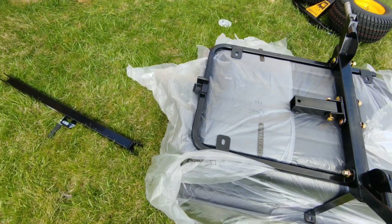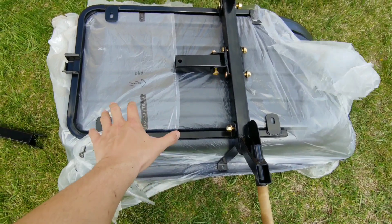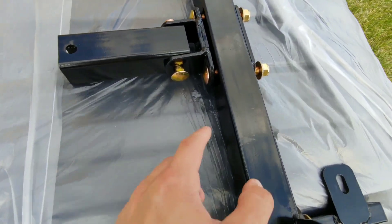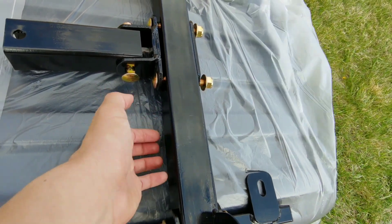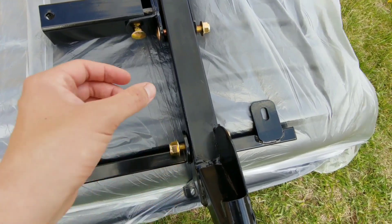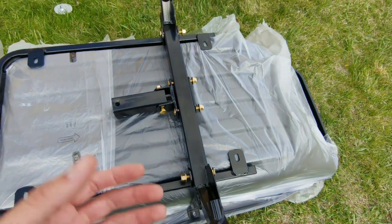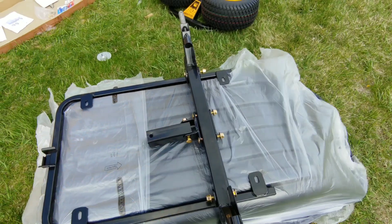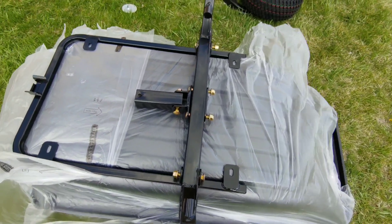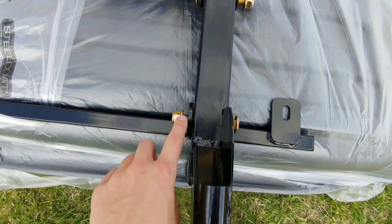This part is a bit more technical. I laid a drop cloth down on the plastic part of the trailer because there are little holes in this hollow frame. What I did is pour a little bit of motor oil in this piece and sloshed it around slowly to coat the inside, because moisture will get in those frames and it can rust over time. Just a little bit of motor oil — I was really careful not to get it on my threads.